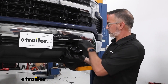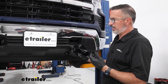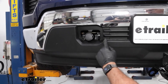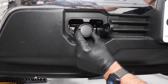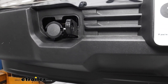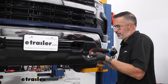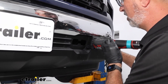Our next steps are going to be trimming the fascia here for the base plate and the safety chain plate. There are a few things to consider on this truck — we don't have fog lights and this is a Z71 package. We did the passenger side first so you can kind of see what we need to cut. We had to cut down here, over, and then up to allow for the base plate tab to fit and the plate. Keep that in mind when you're trimming the front. Just do a little bit at a time. Today I'm going to be using an oscillating tool to cut this. This is just plastic — you could cut it with a razor knife if you're careful, or anything else you're comfortable with.